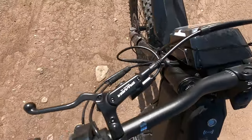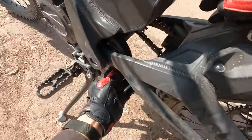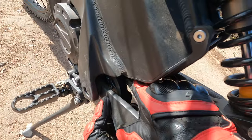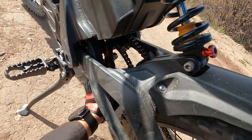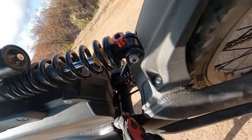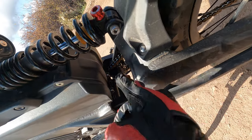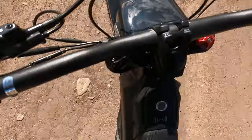There's also one other thing I saw a lot of people talking about — you see the brake line back here? See how close this is to your actual belt and your chain? I would always keep an eye on this. I have seen people rip off their brake line from rubbing on things. So we'll continue to keep an eye on that.